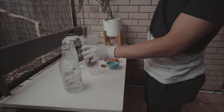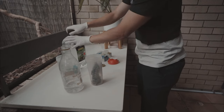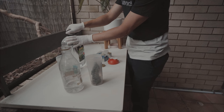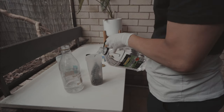Now this will require at least 2 or 3 baths of methylated spirits to clean off the turps before we wipe down the chain and give it a quick dry with the blow dryer, and then it'll be fully prepped for the wax.